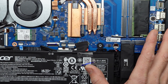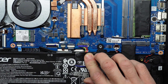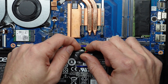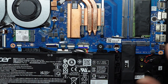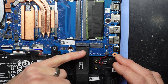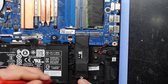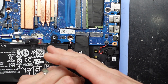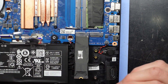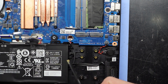Upgrading to dual channel RAM would give you some extra performance. To disconnect the battery, get a nail in on both sides and just pull slightly — when they're disconnected I'm happy to touch various components in here. Over here is our NVMe drive, which looks like someone has been in here before — exactly what the customer was saying — and there's a warranty sticker, maybe even a sticker that says Lenovo. I'll take this out.